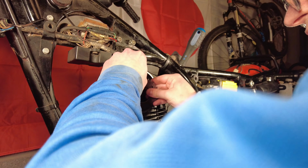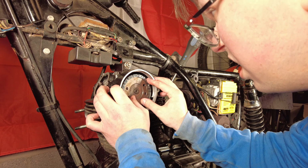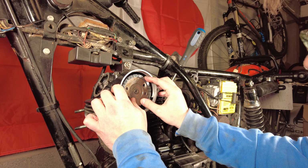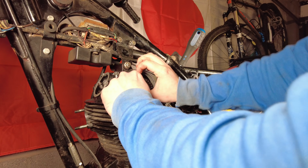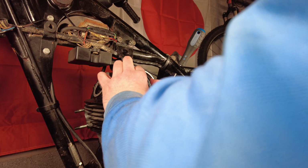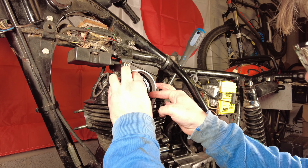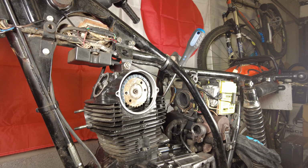Try not to obscure what I'm doing too much. You might want to see if you're watching the video. It's difficult to do without chopping your fingers off. It turns out, even nearly in line. No, I am at least a tooth out, if not more. And now I've gone too far the other way. Ah, that is bang on, actually. And hold this crankshaft steady, that looks to be about spot on.